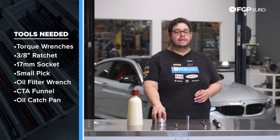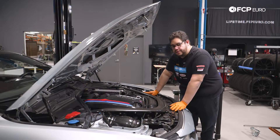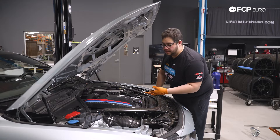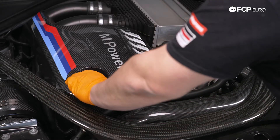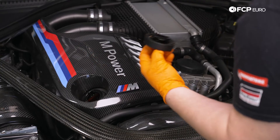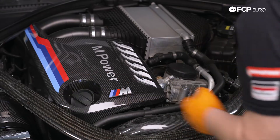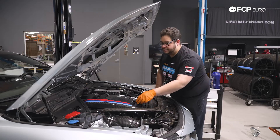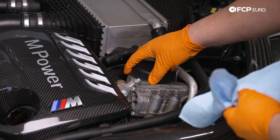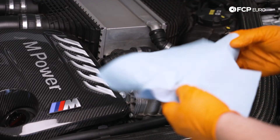Both the funnel and the wrench will be linked in the description below. First things first, under the hood of the F82 we're going to start by breaking the vacuum seal by removing the oil fill cap — that's going to allow us to drain everything a little bit easier. If you're outdoors, leave the cap on just at an angle that'll still allow everything to breathe. While we're up here we're also going to work on breaking the seal at our oil filter, letting it drain for a sec, and then pulling it out so it can drain while the oil is draining.